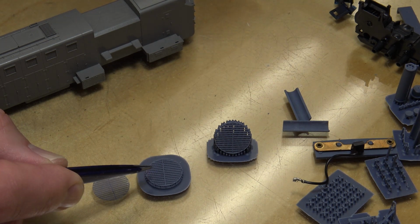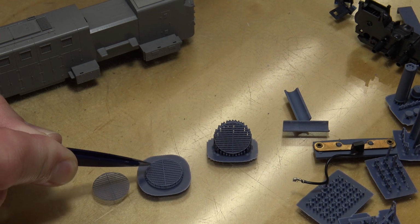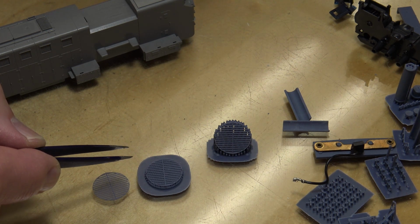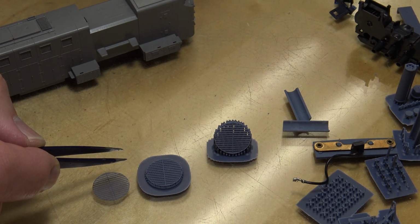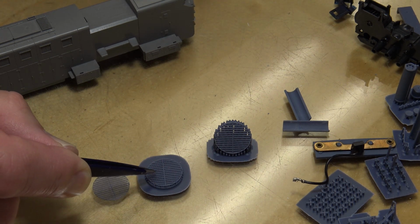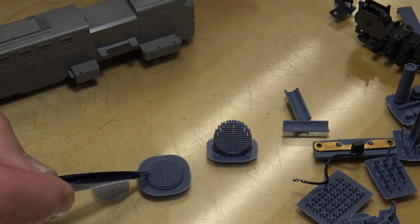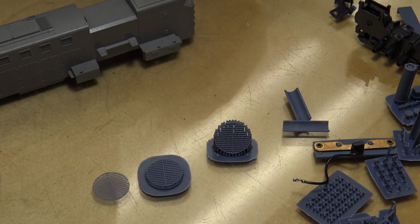The bars that go in the direction of the hood, front to back, are like 1/4 inch or 3/8 by 1 or 1.5 bar stock. The bars that go perpendicular are square bar stock that has been twisted, and then welded into notches on the rectangular bar stock. So it's pretty cool. Now I didn't do that, but I did divide these out, get the appropriate amount, and made them look like they do on the prototype.